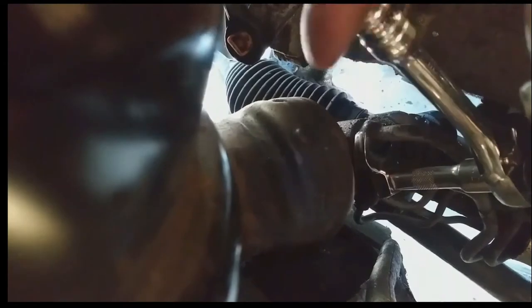These are the power steering fluid lines — the in and out from the rack and pinion. I used the crowfoot on both, but on the first one — the furthest line forward toward the front — I used the 18 millimeter crowfoot, because that line is in a very awkward spot and it's hard to get a regular wrench in that position.